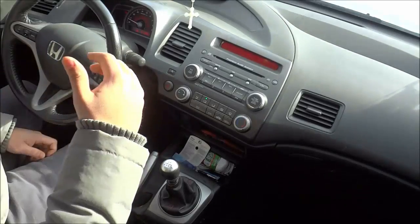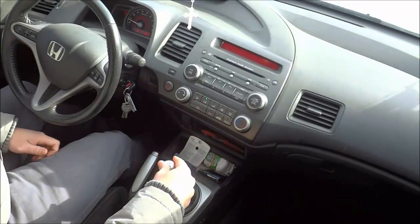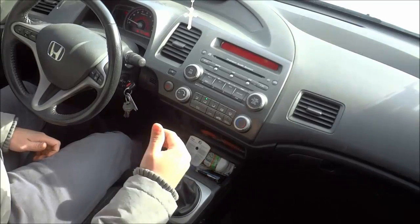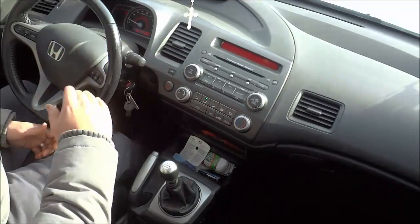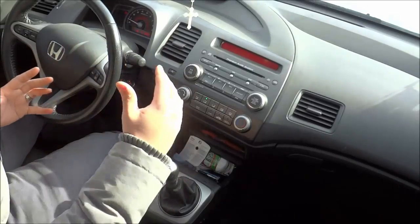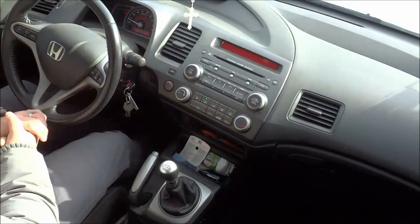In this video, I have given you a tip for driving manual in the snow. All that you have to do is downshift into first gear, and that will allow you to slow down much better and much faster. Just remember to give the gas pedal just a little touch as you are downshifting into first gear to reduce the strain that it puts on your transmission, your engine, your clutch, and so forth. And that's all I have for you today.